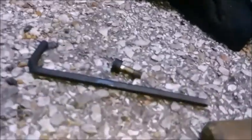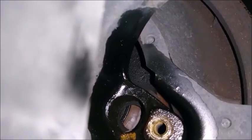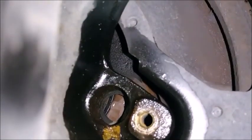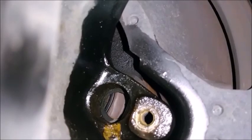I'm trying to get in here for you guys to see. I already moved the bolt that holds the sensor in — it's a 5mm hex. I don't know how well you'll be able to see the ring but I'll try to get you in there. That is the hole, so the ring's still in there. We can see it — if I rotate the rotor, it doesn't look too dirty. The ring's in there, the ring rotates. Here's the sensor — it's maybe mildly dirty.